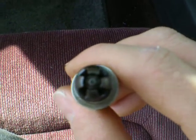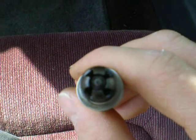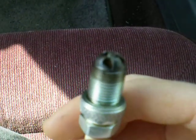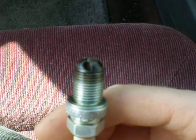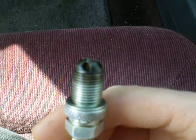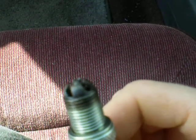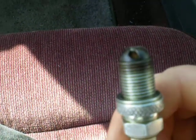To get back to the point, I'm using Richard's Blue Phoenix plasma ignition box on this plug, to see how long they last. So far they're only lasting about 300 to 400 miles on this plug only. And you may not see it in the video, but the center electrode is what's wearing out on it, not the grounds.